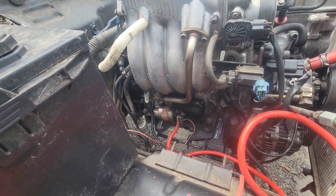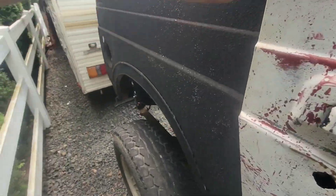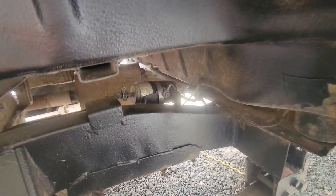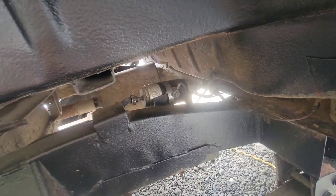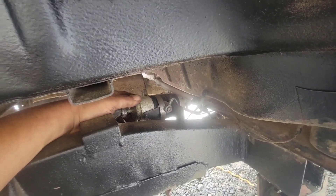I've also noticed that when my wife turns the key and activates everything, I am not feeling anything on that fuel pump, so it might not be working. It doesn't really matter until we can get the engine to turn over, but something might be wrong with the fuel pump as well. I believe a 5-speed and an automatic have two different types of starters — one has a 9-tooth gear and the other has an 8-tooth gear. All the starters I have lying around here have the 8-tooth gear, and as you've just seen, that's not turning this motor over.